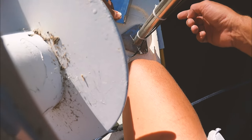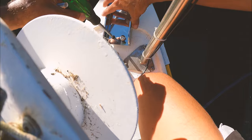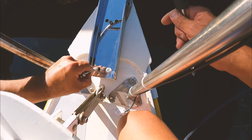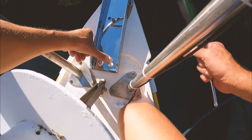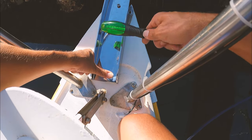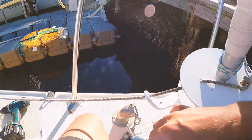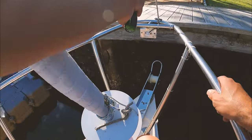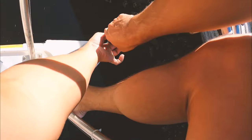It's actually for a big piece of solid polished stainless steel — it was $219, which is reasonable, but still not money I wanted to spend. But this is a critical part of the boat — I'd much prefer to spend a little bit of money than not be able to sleep well at night. OK, we're through. Get these washers here and see how many we need to get it flush, because there is a dip in the deck. I've got five for each side — my guess was five — and I reckon maybe six. That looks pretty flush to me. We'll have to get the bolts through them as well. I'll put a little bit of Sikaflex on there, I don't want to put too much on because I want it to go everywhere. Those bolts are going to be the problem — I'm going to have to leave it like that and then have to get someone to do the top, because unless I can somehow tape a spanner to it, it's going to be tricky.